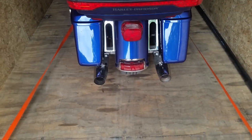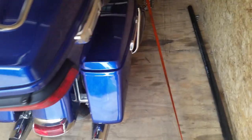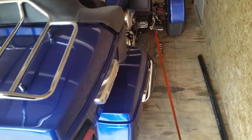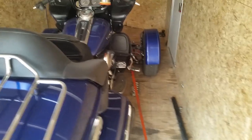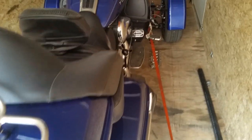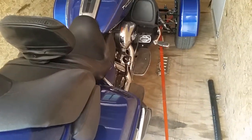The other alternative is you can get by with three straps if you have a mount in the middle of the trailer — you can hook on the back of the bike and that's fine. A lot of people think you have to strap the back of the bike so it doesn't shift from side to side, but it's actually impossible for it to move because the front end is locked and solid, and unless the bike hinges in the middle, there's no way it can move.